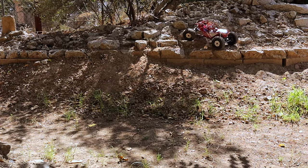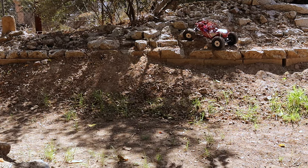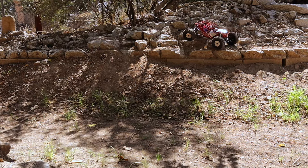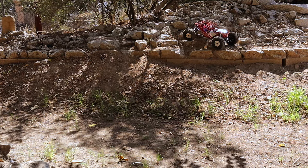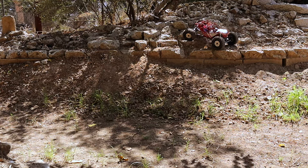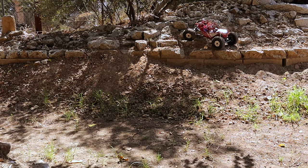Do I feel like I need more weight in the corners? No, I do not. That is the really surprising takeaway for me here. When they were at like 350 plus, I could feel the weight of them, a real pendulum action on the end of the axle. These at 227 complete with the wheel, that's right about where we want to be.